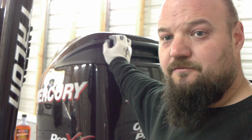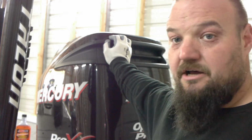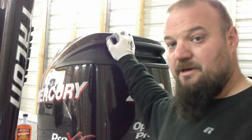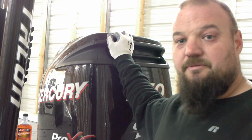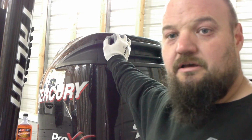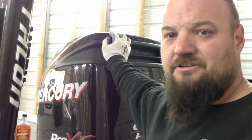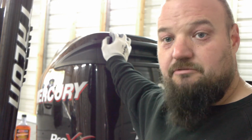Everybody you see on the forums talking about props, knockouts on their props and all that, and what's everybody else's top speed, but many things take that into account. You may have picked up a little water in your vent because you over trimmed and you might have fouled them out. Well, on these Mercury high outputs, they run iridium plugs. It's your choice what plug you put in in the end, but I recommend putting in the NGK iridium plug.